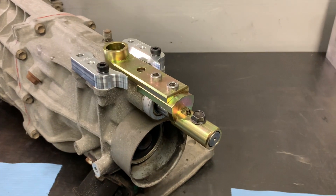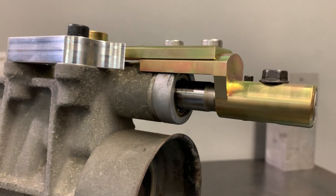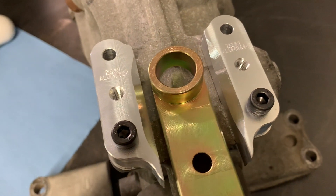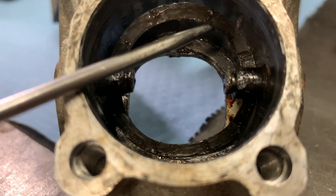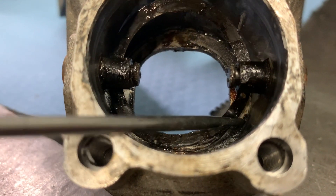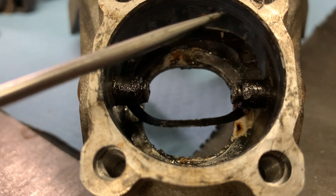Here's what we have so far: we have our shifter sleeve and shifter lever attached onto the selector shaft, and we also have our shifter spacers attached to the tail shaft. The next step is going to be to remove the little spring washer out of the old shifter stock — this is going to be reused underneath the shifter assembly inside the new shifter housing.